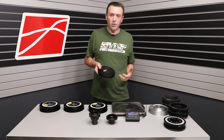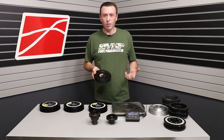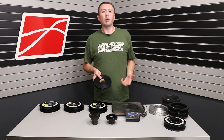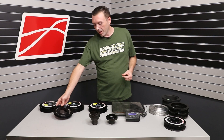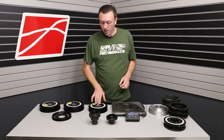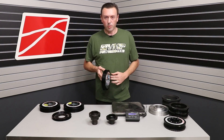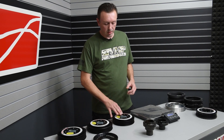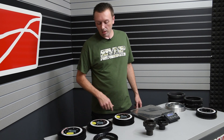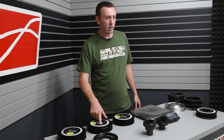This really speaks to where Coyotes have gone in the high-performance and racing world. Water pumps are electric, alternators may not be used on all-out race cars — so this part can be discarded if all you need to do is drive the supercharger. In front of me on the table, we have several different designs. This is a 10% overdrive 8-rib, and this is a 20% overdrive 8-rib.